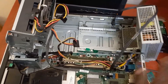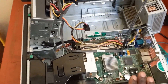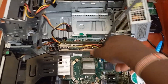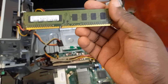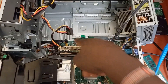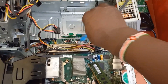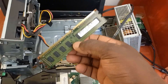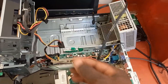Unfortunately my computer did not work — all the recommendations did not work. For those of you watching, you can try these recommendations: one, remove the RAM stick and use an eraser to clean the terminals; after cleaning the terminals, also clean using a brush where the RAM usually sits; then reinstall the RAM. If the problem persists, buy a new RAM like I did and try to use it.